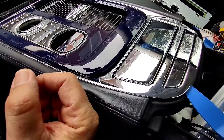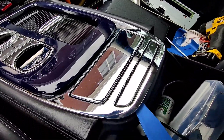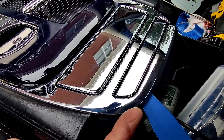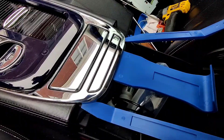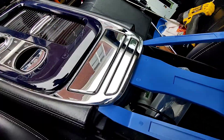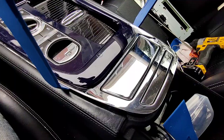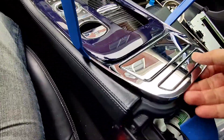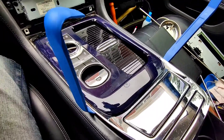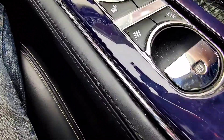The next step is to remove the center console. I think it has the same friction clips and you want to start at this end and work your way around, just like we did the front bezel. It was difficult to get it started here but with a little deliberation we were able to force a plastic clip in. We've got this started and we're going to slowly try to work our way up. This whole thing's plastic — you have to be careful not to crack the edges. We're slowly working our way up with these tools.